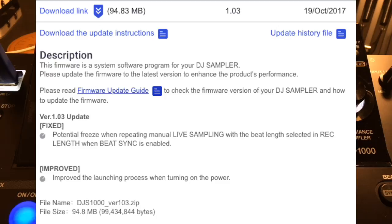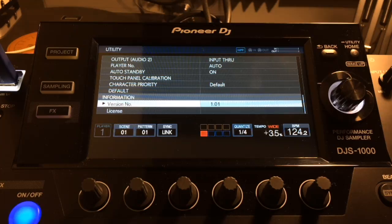So whilst I'm here, I need to use my USB stick, which is just up here on the top left. I'm gonna press and hold the USB stop button, which is just underneath. It's just off screen, I'm afraid. But that will flash and then it will stop and then it's safe to eject the USB stick. So it's really simple. You just download the firmware, so I'll put a link in the description. And then you just copy that to the root directory of your USB stick and then you're all good to go. So I've copied the firmware 1.0.3 update to my USB stick.